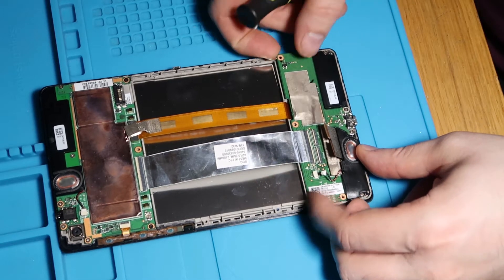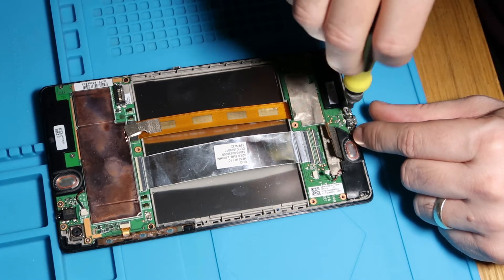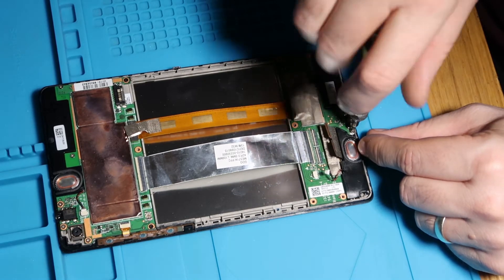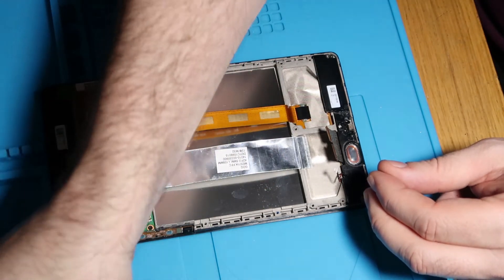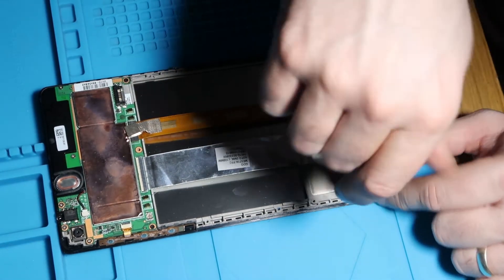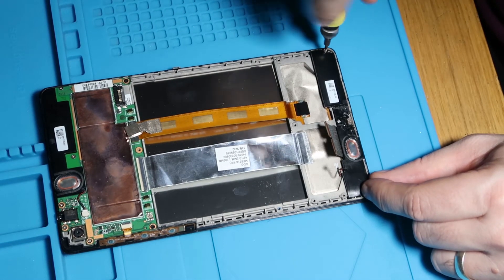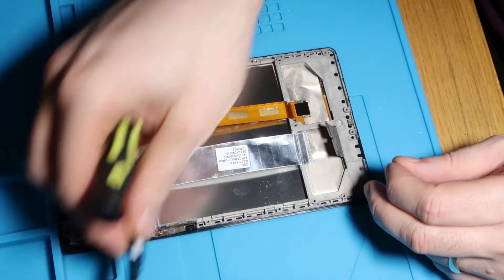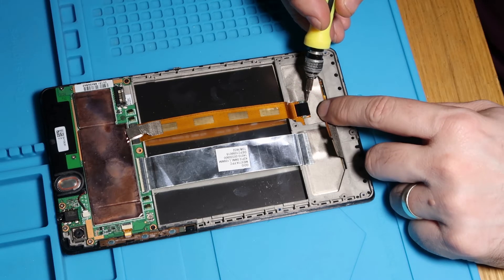So that's our charge board. That should just lift out if I hadn't missed the two bottom screws. So we'll have a habit of missing screws in there. So that's our board out, nice and easy. Put that to one side. We'll just disconnect our speaker while we're here as well. So that's just got a couple of screws holding that way. It was actually pretty nasty where it was — one clearly tried to solder without removing it. So hopefully that still works. I'll give that a test so we'll soon know. So with the bottom of our board, we're more or less done.